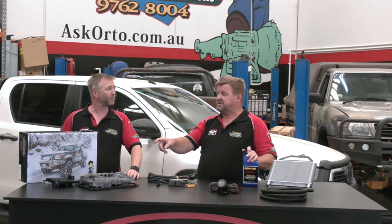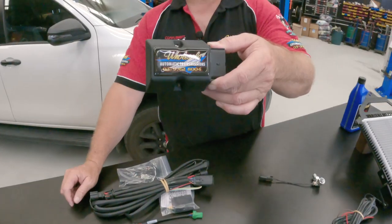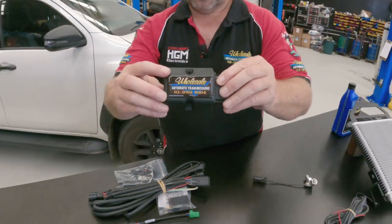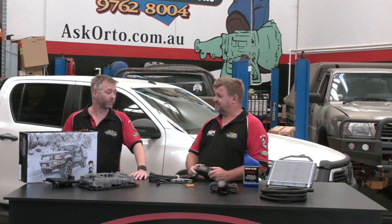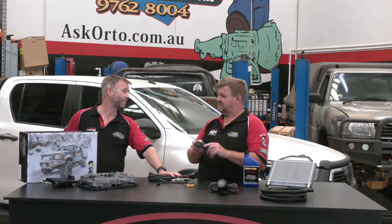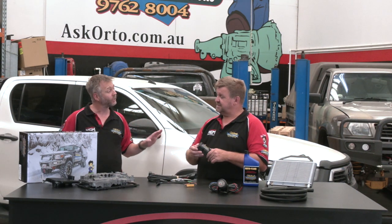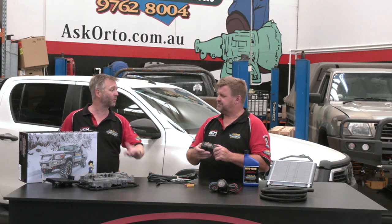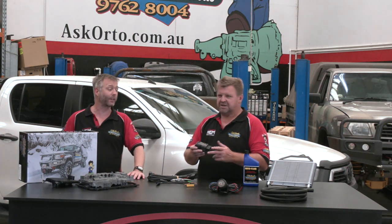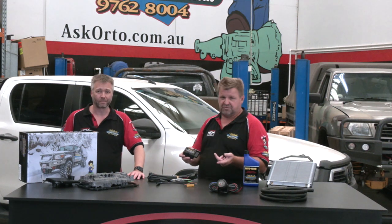That's the first item — probably one of our biggest ones. Now we move on to the second one, which is a piece de résistance. A lot of people have been waiting for this. We previously only had it for the 200 Series, and this is the new Nomad Lockup Module and Kit, which we now have available for the Hilux — for the six-speed Hilux. This is an amazing bit of kit — the lockup controller of the future. What sets this kit apart is that it actually taps into the CAN bus in the vehicle to get all the information it needs and make its decisions on when to engage automatic lockup.